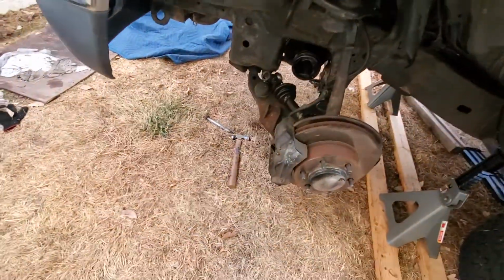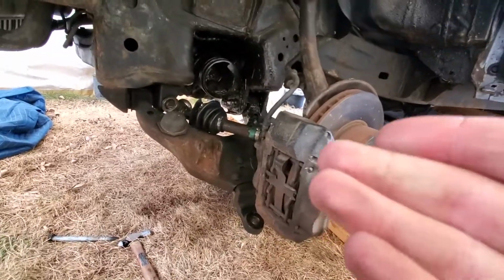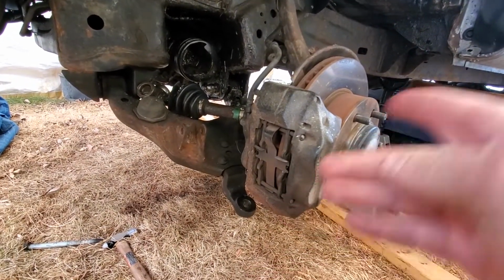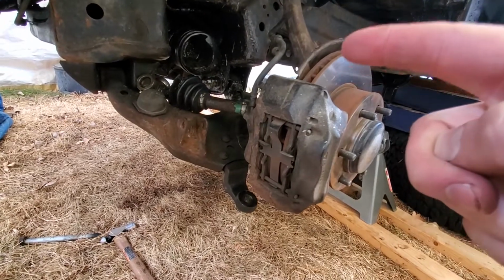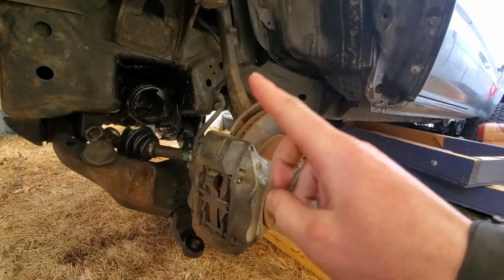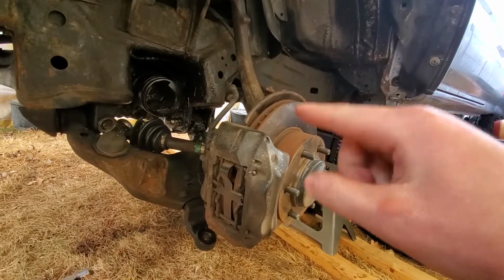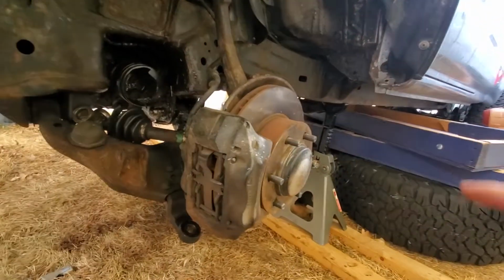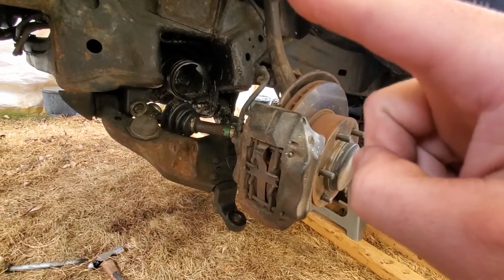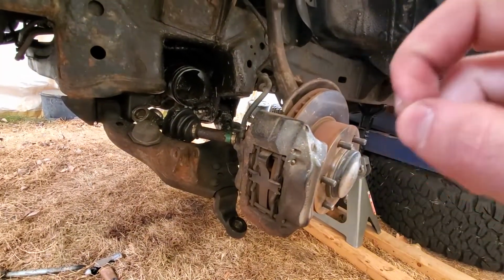So this is it. We have the coilovers out. And this shaft, this is the axle that was broken. Coilovers out, lower ball joints popped out. We need to take the drive shaft off, and then we could take the upper control arm, pop that upper control ball joint out. I'm probably just going to leave the upper control arm on and take this whole section off, and then we can take the lower control arm off. And then everything the same on the other side as well. And then I'm probably going to go from there.